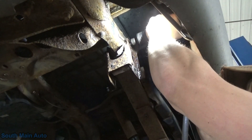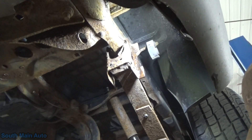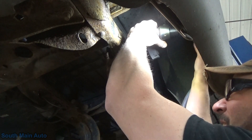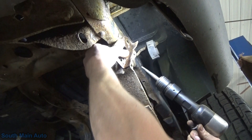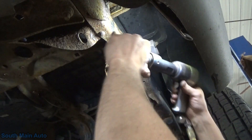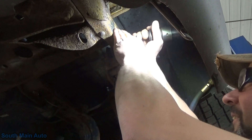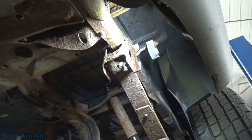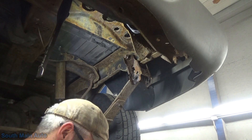Almost pushing through by hand now. Swap out bits - we're going to be too long. So close, just can't quite make it. Alright, it's torch time. We'll just blow the head off the backside now that we've got it moving and drive it through the other direction.